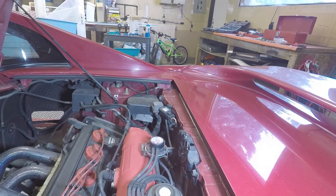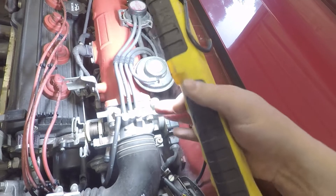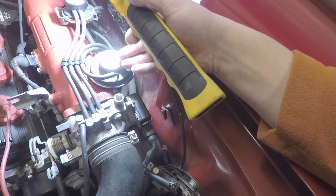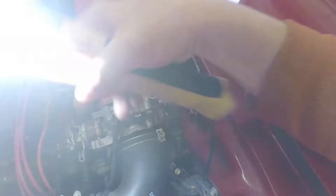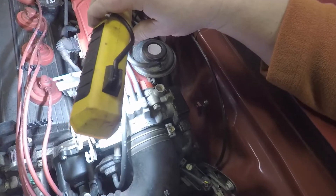I'm not a mechanic — I'm just a guy who likes to work on my car. If I do things wrong, it's because I don't always know what I'm doing. I read stuff and have some guesses, so come learn with me. To change the intake manifold gasket, I need to take the throttle body off and the EGR off as well, then put some goop around there when putting it back together. I had bubbles coming out of the throttle body shaft and I still don't have a solution for that.